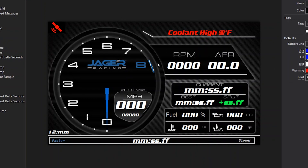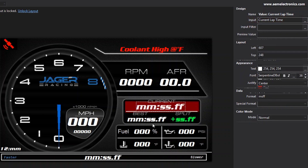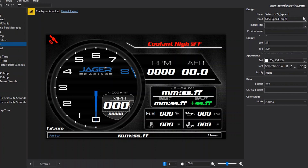As you can see here, I have the Dash Design layout. This is actually the dash design I had from the Subaru, and I'm just manipulating it to utilize for the Miata. I made a few changes — this bar down here at the bottom is going to display various lap time aspects: my predicted lap time, current lap time, best lap time, and the split. I also don't have a fuel gauge on the Subaru, so I need it on the Miata. Also oil pressure, oil temperature, and water temperature. Little other things like the odometer are also captured here, and all my warnings are up in here.